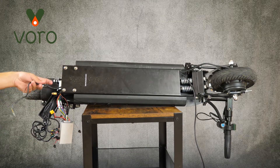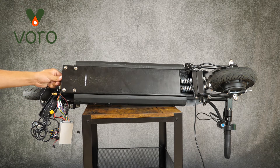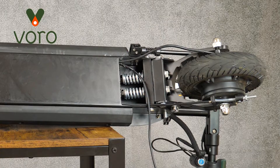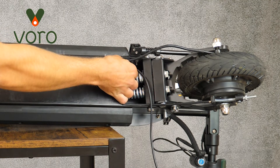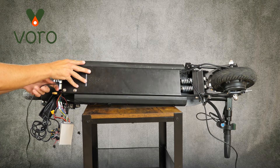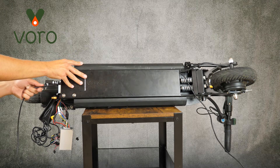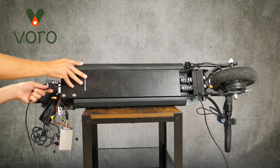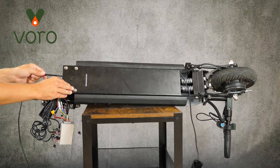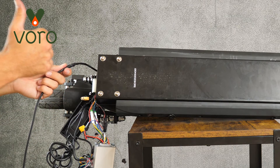On the front of the scooter, go ahead and locate the fender wire — remember, it's the wire with yellow, blue, green, and brown wires coming out of it. Very carefully pull that through the scooter, and when you reach the portion that we used electrical tape on, it will help to push that through with your other hand. You'll notice on the other side that as you pull that wire through, it'll bring the new fender wire through. This is the easiest and most efficient way to get the new fender wire through the scooter. Once the electrical tape portion of the wire is at the other end, you're okay to stop.